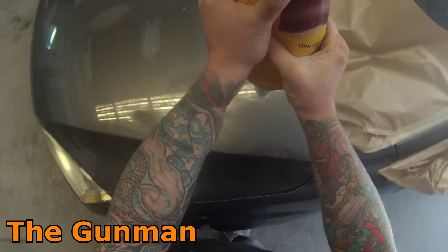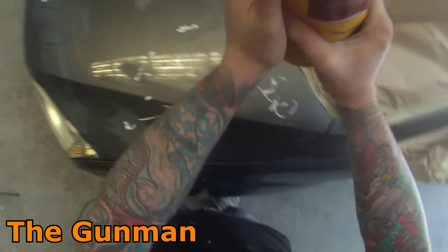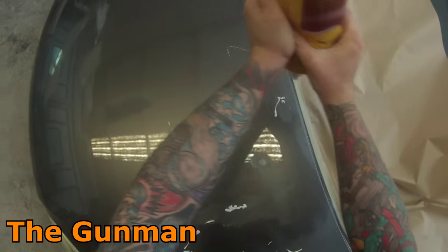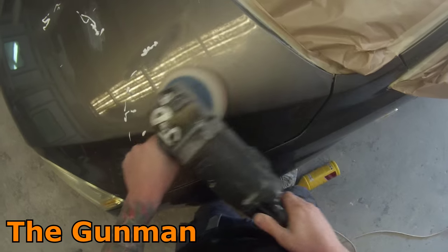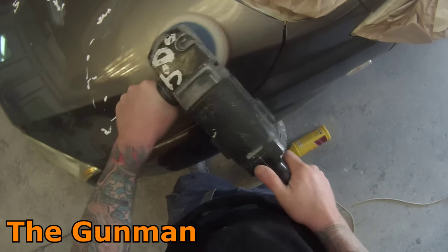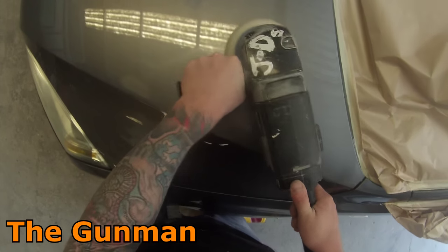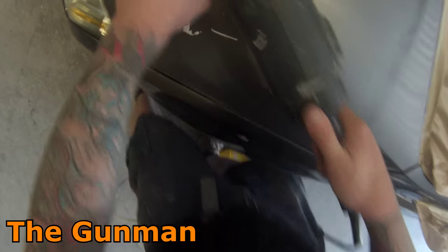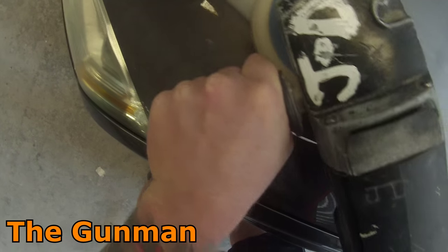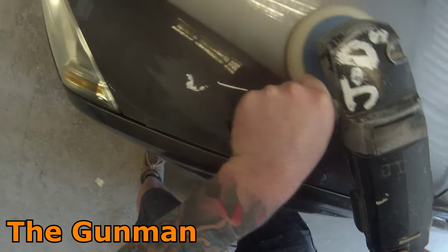As you noticed, I gave the entire car a good mask-up because we're doing a full cut and polish - polishing both sides, the tailgate, bumper bars, headlights, and tail lights. You can see those patches I de-nibbed - that's a pretty average amount of dust bits in a panel. There was one little dry patch where you see me buffing - a bit of extra orange peel - so I gave it an extra sand with the block in 2000 and it was able to buff up. There was still enough clear there.